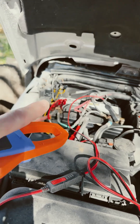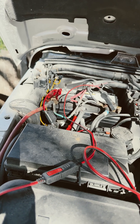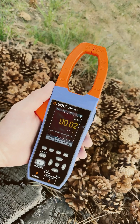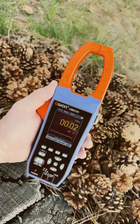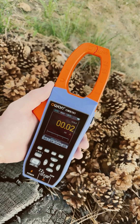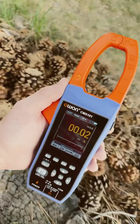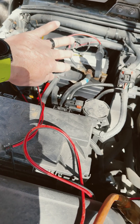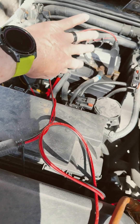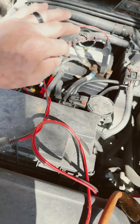Now I'm wondering how much current is going into the Jeep — maybe leakage current — and I'm going to check that. It's possible that 20 milliamps is going into the Jeep, so maybe I've left something on, maybe that's normal. I did that by checking the two red ones. There's two black ones going out. Now this is the alternator going in, so I'm going to try these two black ones.